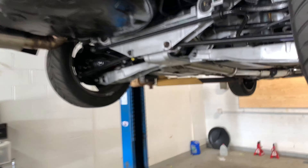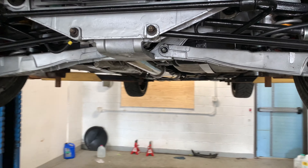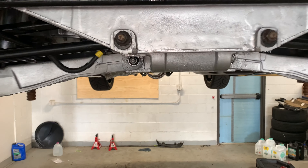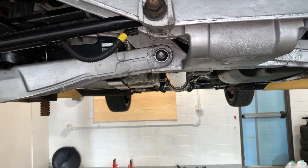We rearranged the v-bands a little bit - you can see we've got more v-band clearance now. This one moved up here, and of course we got this spaced out with nothing hitting the prop. I can shake the entire car without any issues. Two hours in and got a good amount of stuff done. You can see the exhaust kind of bows a little bit down but the clearance isn't that much worse than the rear subframe - I think the fitment's good.